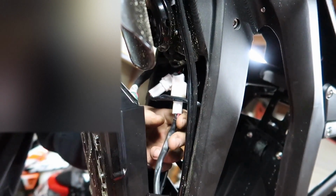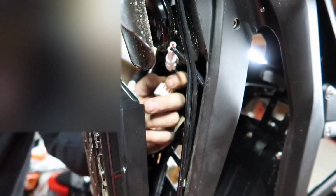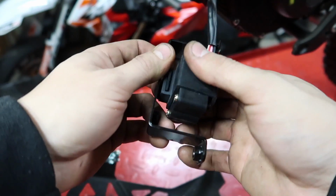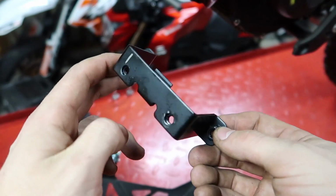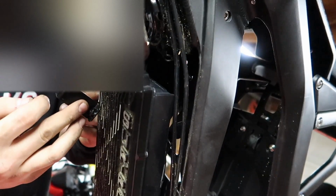Alright, so just go ahead and pull your tilt sensor, whatever you want to call it, pull it down, go right to this plug-in. And I'm also going to tape this connector up, even though it's buried up underneath the frame. Still gonna tape it up. All taped up. Now we can go ahead and remove this tip over sensor from this bracket. And now we can go ahead and reinstall this bracket and reassemble everything. Let me go ahead and tuck these wires back up underneath here like they were. So when you install this, make sure you install it with the holes to the lower side.